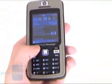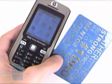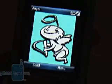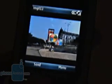The iPAQ 500 is targeted at first-time smartphone users and comes at a low price compared to similar products. In order to reduce the price, the display quality suffers — it is 176x220 pixels instead of the standard 240x320, which is about three times more. The main drawback is that it won't be able to run applications for devices with QVGA displays, which are pretty much the most common Windows Mobile devices currently sold on the market.